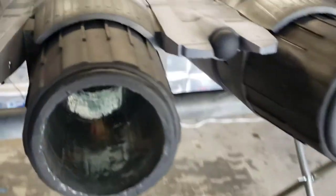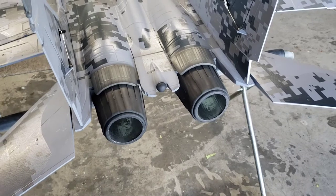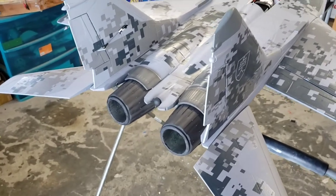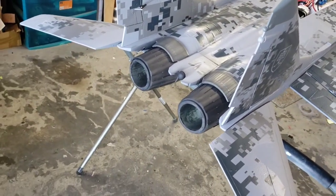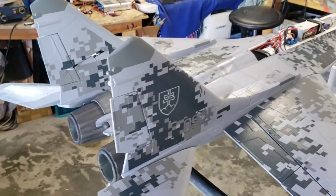I have RC Geek center burners on this, and I did the metal tape inside. I did try smaller tailpipes with mylar but didn't really notice much of a gain in performance versus other guys' MiG-29s that I flew with. I flew with some friends who both did my cheater hole mod, and top-speed wise mine versus theirs — both with the cheater hole mod and the inlet mod — was very similar. So I went ahead and took the tailpipes out, because at that point all they're doing is adding amp draw by constricting the flow.